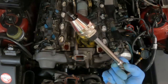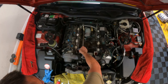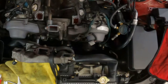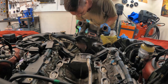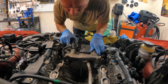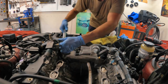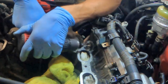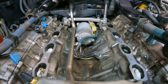You don't have to do that two-nut trick — this tool just takes it right out. And that's why I took that crossover off, so you can get the right angle on it. FIPG is applied. Next, you clean up these gasket mating surfaces and make sure junk doesn't go down into the intake side of your head. Here we have it — nice and cleaned up.